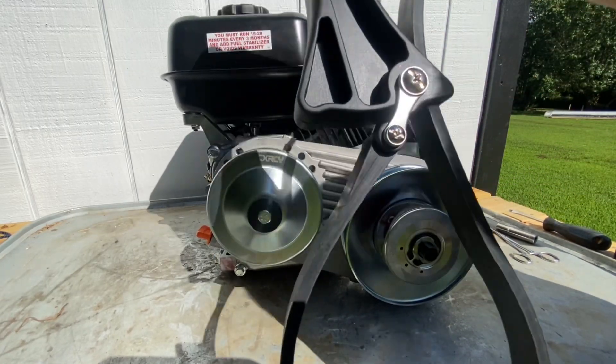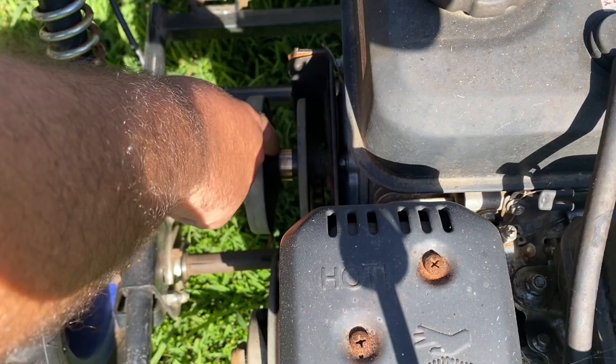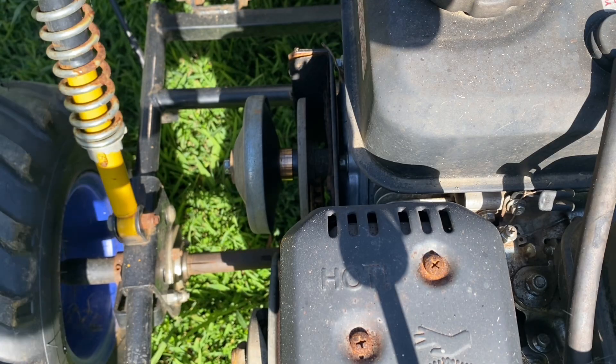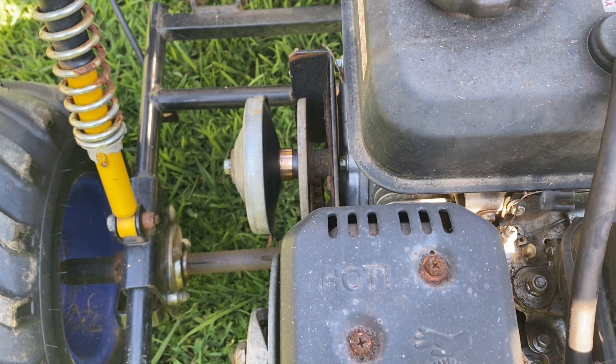You can see that held the driver in place while we tightened the bolt down. Just so nobody asks — even if the belt came off the driver, it can expand more and those springs and weights could potentially move, but I'm going to rev this up and show you how much clearance there is between the outer housing and the inside. You'll see there's no way for those weights to make it out of that little gap even if the belt came off, the pieces separated, and the springs broke all at the same time.